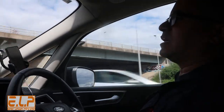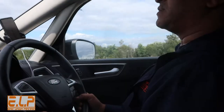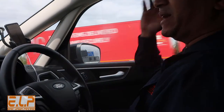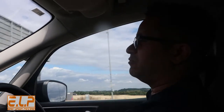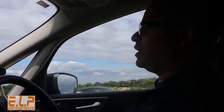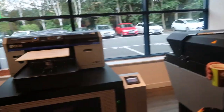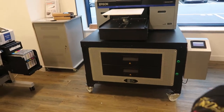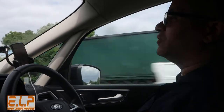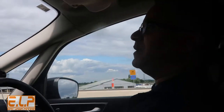With the Epson F2100 printer, I know that it now has a cleaning cartridge in there which has cleaning fluid. So when you run the head clean, it uses the cleaning fluid to clean certain areas, or it does that with the daily maintenance of the machine. I know people say that the Epson itself has starter cartridges, but as far as I know it's not necessarily starter cartridges. I spoke to Express and they said when you first switch the Epson F2100 on, it uses 25% of the ink for priming — but that means the ink is still in the machine somewhere and can still be used. I know the inks are quite high in terms of pricing, but if you've got to do less head cleans and less maintenance, you're going to be using less inks at the end of the day.